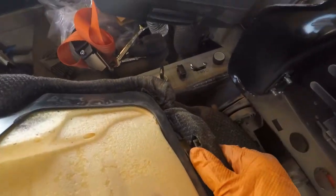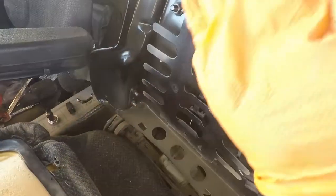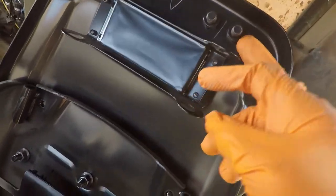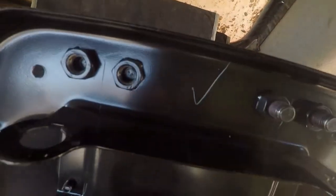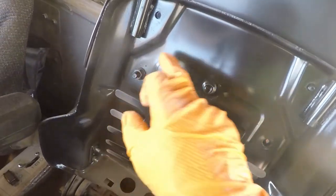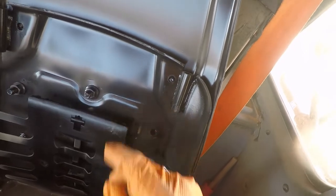We've got the back of the seat off. It's got these little clips right here, and those are gonna go into here. You'll click the bottom in and then just fold the seat back up. There's one of those screws we can't get all the way out. These are the nuts that are in question — they should be captive. These two are captive nuts; you can see the little tack weld there on them to hold them stationary. These ones I have no idea why we didn't think to do that on these three bolts. There should be one here, but somebody's already been here, obviously changed this seat belt out, and now that bolt is gone.